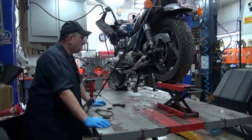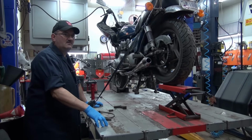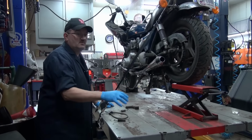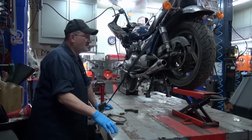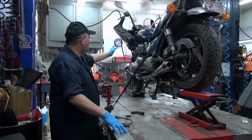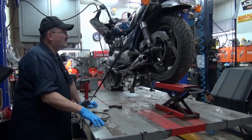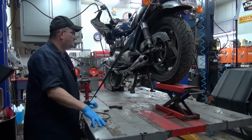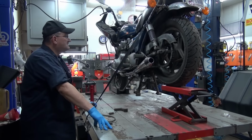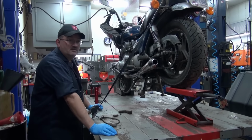So now that being said, we got to talking, and he said he likes his old bike. He's had it since it was about a year old, with only 3,000 kilometers on it when he bought it. So he's had it a long, long time. But he said the people that have been working on it haven't done the job for him. And I said, I always liked that style of bike. I never did like the fairing. And he told me his son didn't like the fairing either. So he said, take the fairing off. So that's another job. And we also got to fix the rack yet. And then he said the clutch fluid and brake fluid has never been changed on it before. So when we did the moisture test last night, it was up in the red, off the scale. So we're going to be doing a brake fluid flush as well.